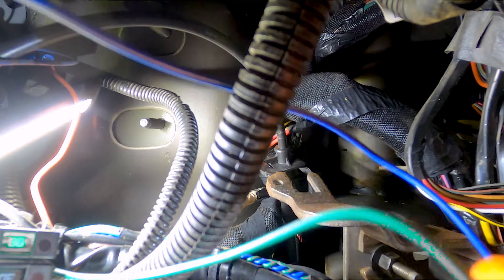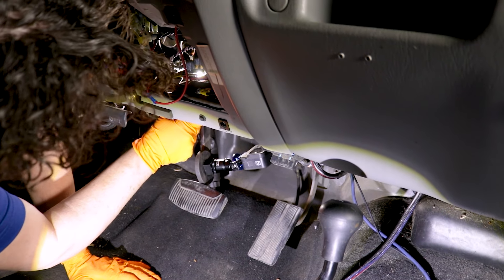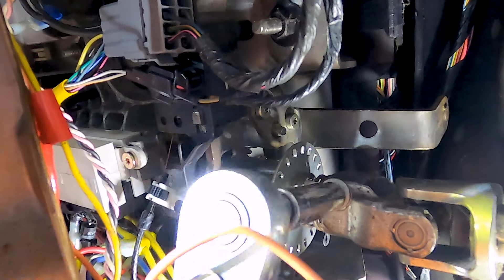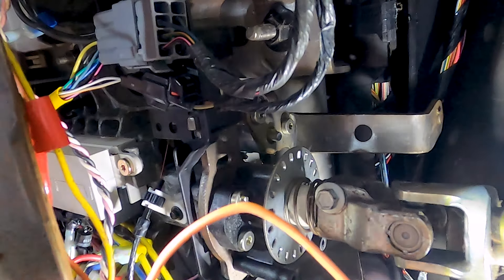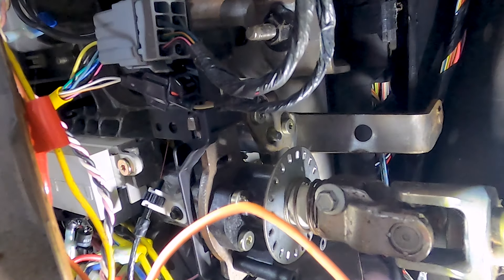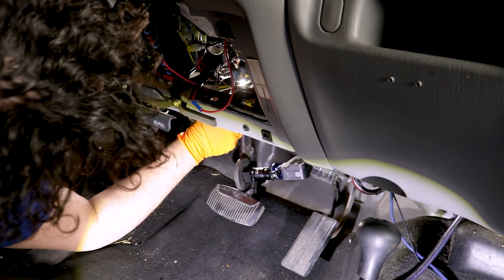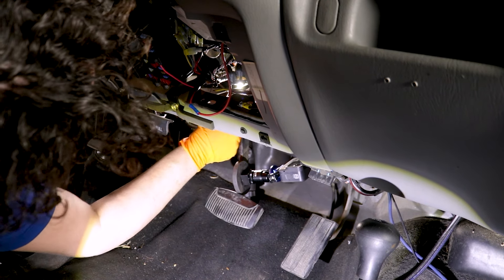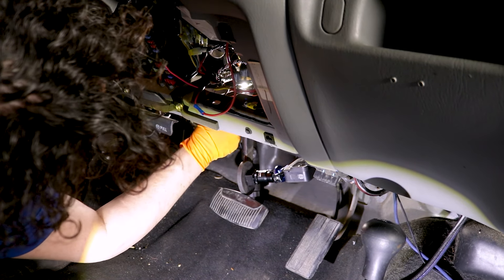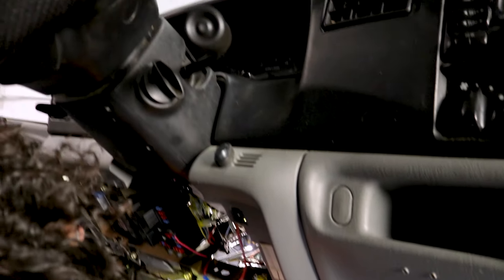Hopefully you don't have all these extra lovely wires that are for a plow. Here we have the steering shaft that goes out to the steering box. There's a 10-millimeter socket — it's probably actually an 8-millimeter bolt but it's a 10-millimeter socket. You're going to loosen this up. This is notched so it can only go in one way. I like to straighten the steering wheel out before I take this out, and you don't want to spin your steering wheel.